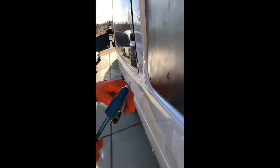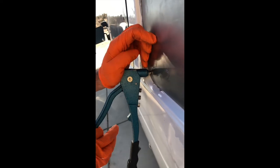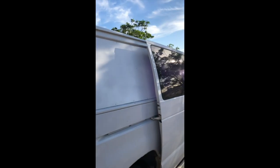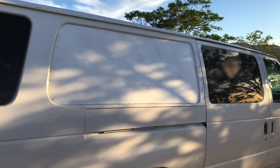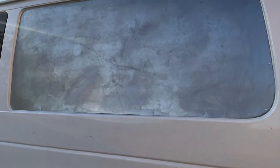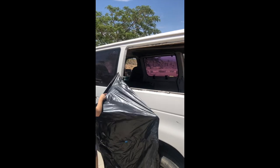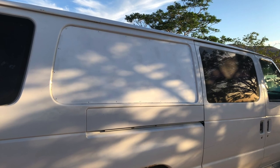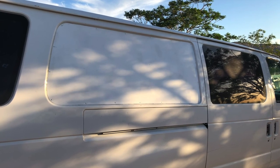A few issues we had were with the steel rivets catching, so we had someone on the inside pushing the rivet back out. As I pushed the rivet back into the gun, this ensured the rivet was clamping the panel properly. At the end, the window was super tight — no water leakage, no air leakage; we tested it with a hose. It was durable, strong, and secure. We then spray painted it to blend it in. It took us about four hours of work. We had to make a template for both sides — we thought they'd be the same, but they were both completely different.